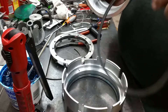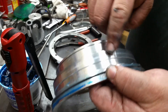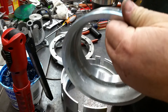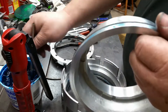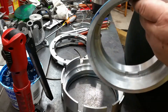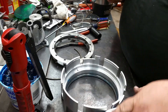Put your outer seal in like so. Now this here is your actual seal surface — you can see it's got a little bit of a scuff mark on it; that's what we want. Leave that on this one. Again, make sure to get your bevel on the bottom side. Lube up your piston seal — alright, that's all lubed up.